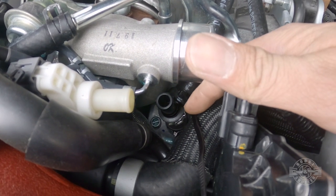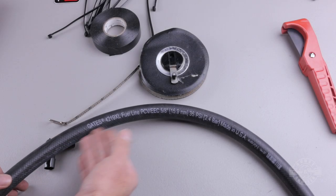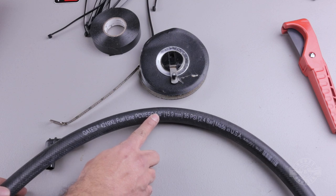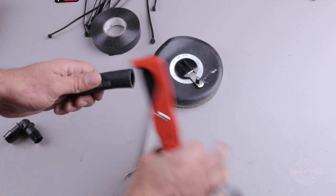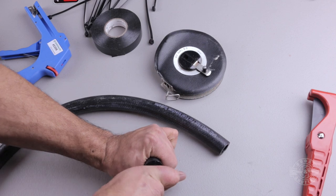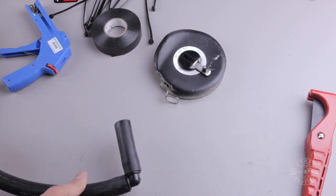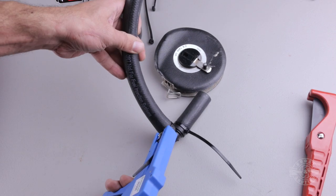Back on the bench, find the 5/8-inch breather hose — the thicker one stamped with '5/8' right on it. Measure exactly 3 inches off the end and use hose cutters to cut it. Grab the included 90-degree fitting and put the 3-inch section on one end and the remainder of the hose on the other end. Grab two zip ties and secure the hose ends properly.